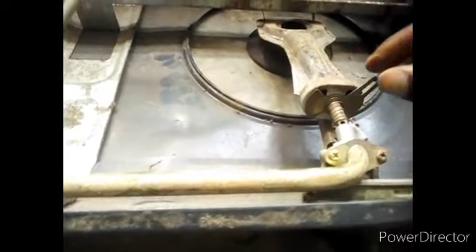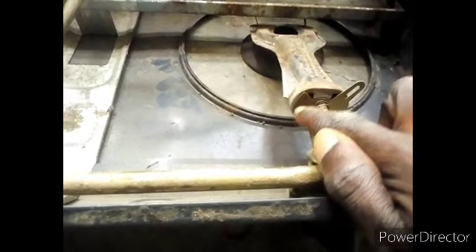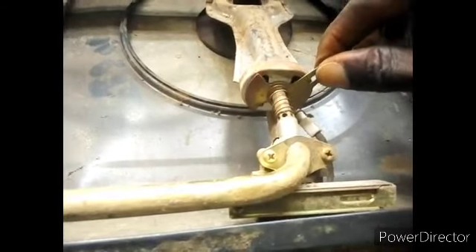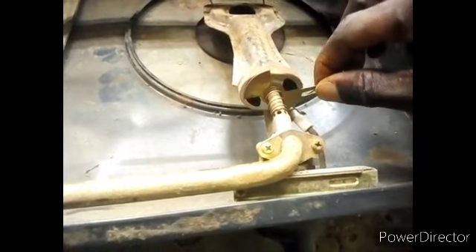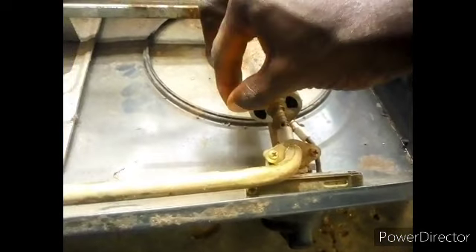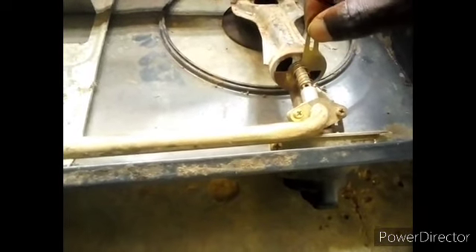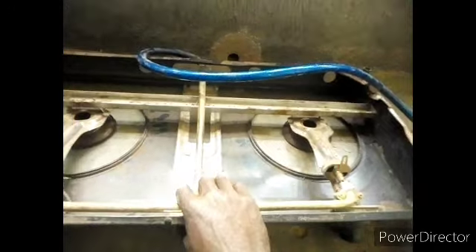This is the particular one I'm talking about. You see something like a wing — you see this wing. You can turn it this side or the other side. Look at it closely: this wing is meant to close or open a hole. This one here is totally closed. So you need to be turning this wing while the flame is on — just put your hand on it and keep turning. It works like a carburetor. For gas to have a blue flame, it must have a combination of air and gas. If that hole is closed, there is no air intake, and that is what causes the smoky yellow flame.